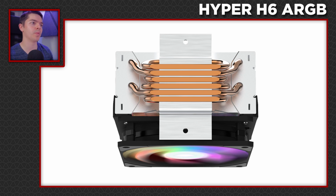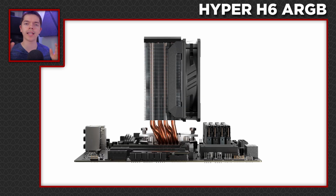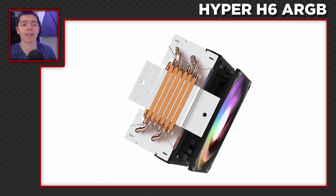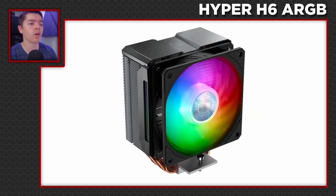So in terms of specs or features, we've got the gunmetal polished or brushed aluminium top cover. We have low profile asymmetrical heat pipes. Good RAM clearance is essentially the target there. They have extra dimensional heat pipe contact, which is basically direct touch heat pipes. Typically that's not that great for really large sockets or really large die CPUs, but we'll have to see how it performs and what reviewers find when they're using those kinds of large sockets. And you get a Sickleflow 120mm ARGB fan with it. And another feature is an extra fan bracket.